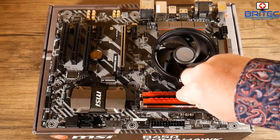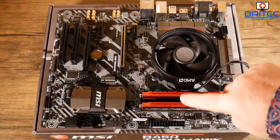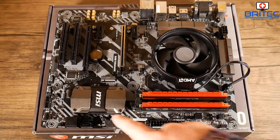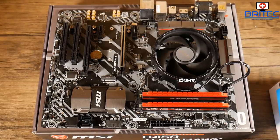Put the other stick in. Your motherboard manual will tell you exactly which slots to populate to get the best performance — check that if you're not familiar. The little red accents on the board and the red LED tie in nicely. When you're on a tight budget, things like color-coded cables and RGB RAM go out the window — RGB RAM costs a lot more. There's no performance difference between RGB and standard RAM; one just has a bit of bling and one hasn't.